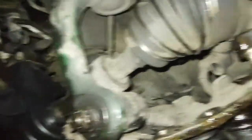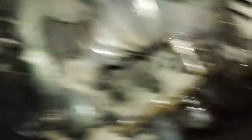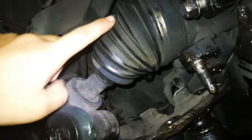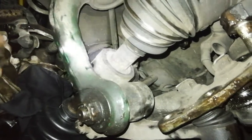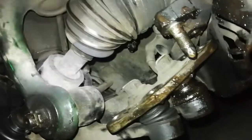So here's my method, from researching old Facebook posts. Usually the outer CV joint is very difficult to remove from the car, but not the inner. The inner CV joint is usually only held very loosely — usually by a snap ring, or even nothing, just the boot and the suspension geometry.